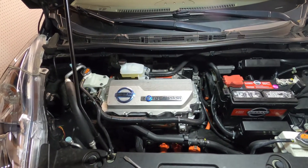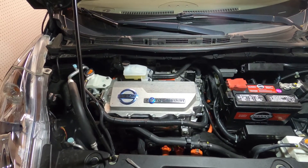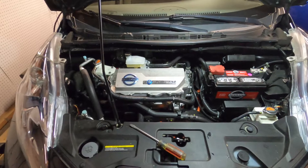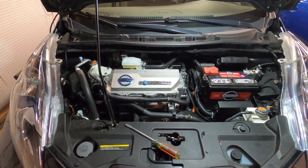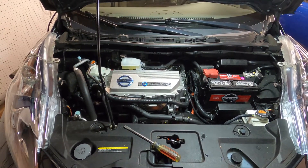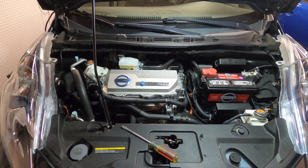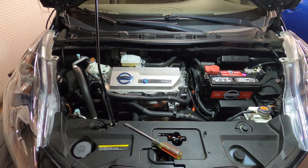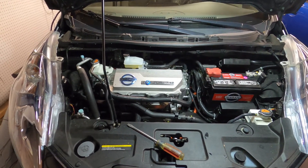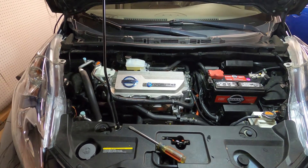On top of that, we had the appropriate draw on the system to verify that the DC to DC controller is actually working. So all the work up front is finished. Our next step is to tear the back interior part of the car apart and acquire a new charger. Hopefully when we continue this on my next round of days off, we should have the part in by then and begin the fix-it process towards the onboard charger — and hopefully fix the whole thing and get it on the road.